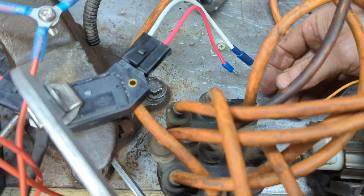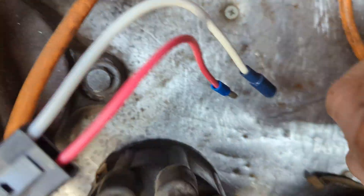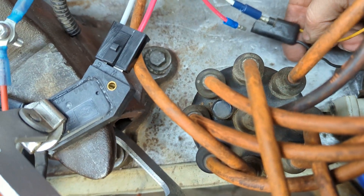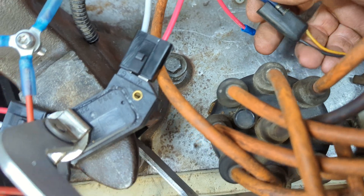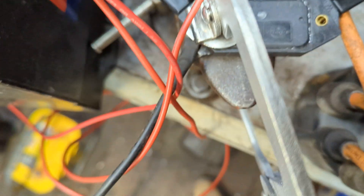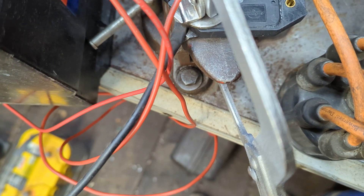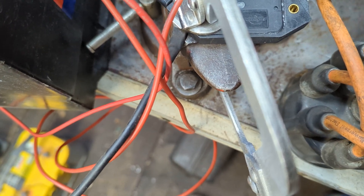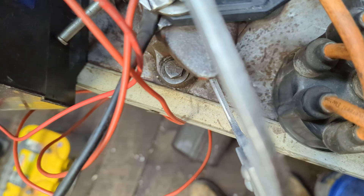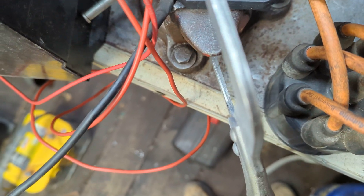The tan or yellow wire hooks up to this white wire which goes over to the G post — the blade lettered G. See, it's the small one. And the red wire just goes over to the blade that's labeled W.